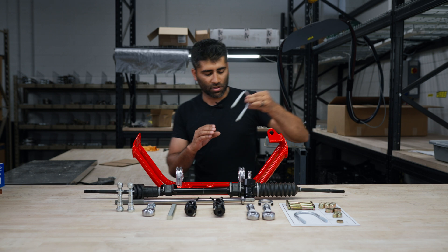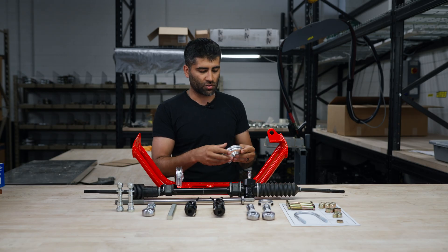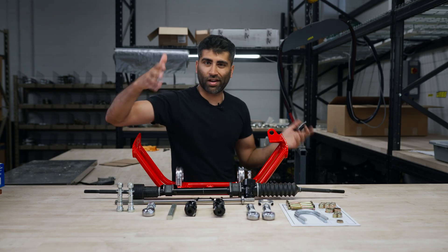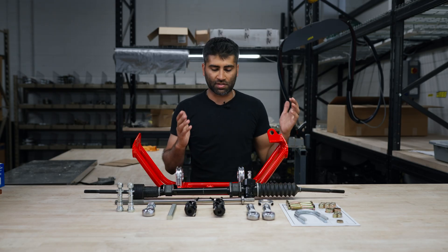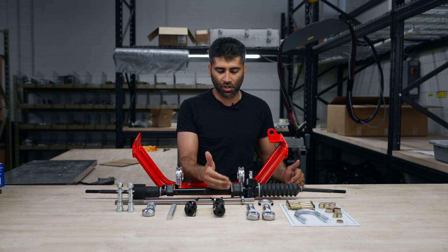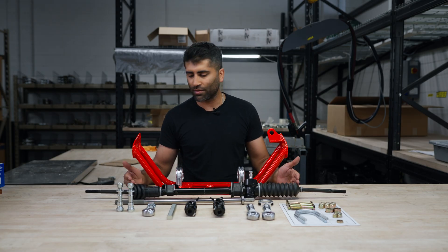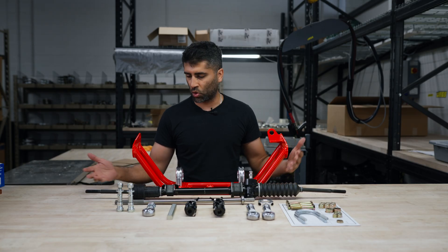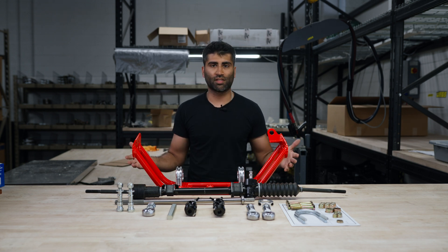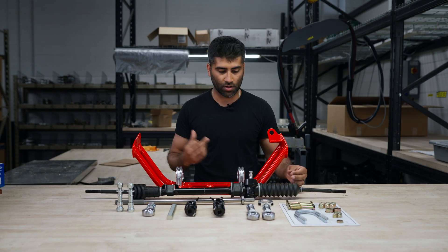The really nice thing about these U-bolts is they sit on the rack clamps with a super low profile, giving you a ton of room for oil pan and other clearances. This kit is designed to use the Ford Escort MK2 steering rack. The reason we really like these racks is that the geometry fits so well with the 510. Other racks have been tried — some Toyota ones and other brands — but the pivot-to-pivot distance in relation to the control arm and the rest of the suspension geometry makes the Escort MK2 ideal for the 510.